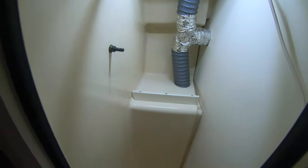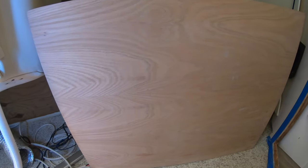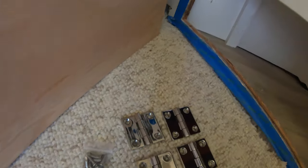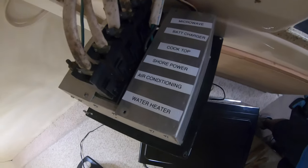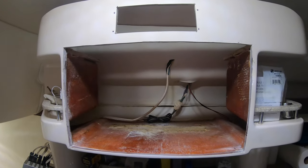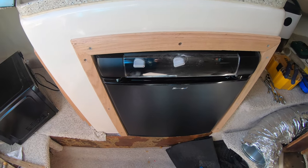This is a storage locker or closet where we put a light and ran the air conditioning duct for the restroom through the wall. I made a door for a triangular cabinet in the galley and made it a little larger so it could hold pots and pans — my wife found some nice stainless steel hardware on Amazon that I put on. Since I had the galley torn apart, I took out the breaker box and identified and labeled everything on the back, and then cut a hole for the microwave and air fryer. Once I had all the trim fitted up, I'm going to take it down, varnish it, and reinstall it with latches on the cabinet door.